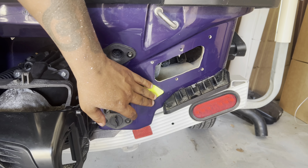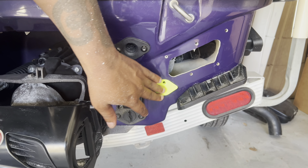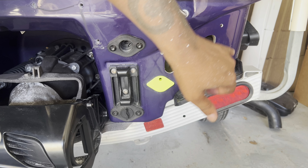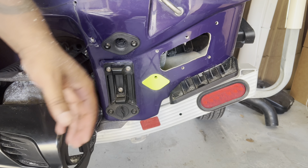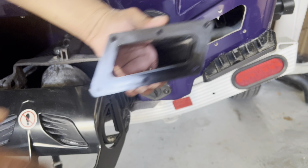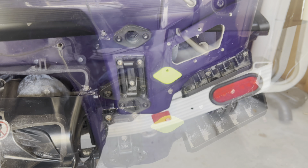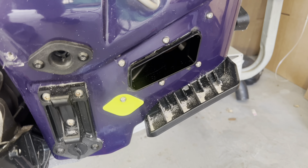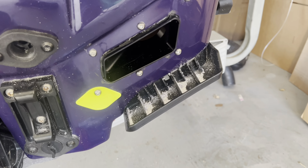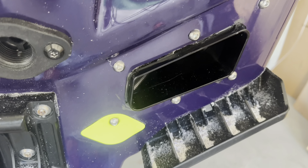Now we're at the fun part. You take your replacement here for your flush port, smash it all the way in — yours is probably going to be black unless you get something custom from us. This is your hole here for your last bolt and this is how all the other holes line up. We're going to stick the outlet through the back and show you the finished product. You want to take your silicone, put a bead all the way around, then stick it in from the other side. The gaskets go on the outside. We got it all in — I put the bolts in there, put the gasket sealer on, and before I put the gasket on top I put the bolts in to bring the flange straight up and let it cure on the back side for about an hour.